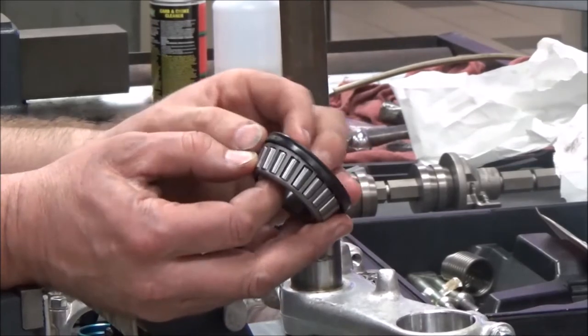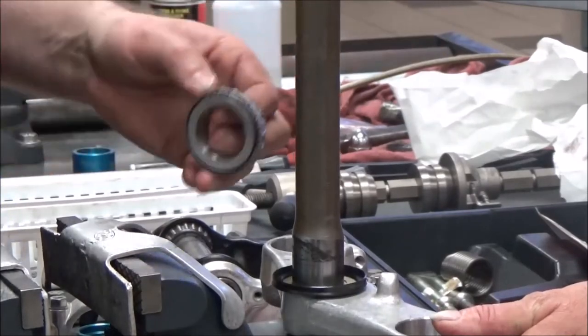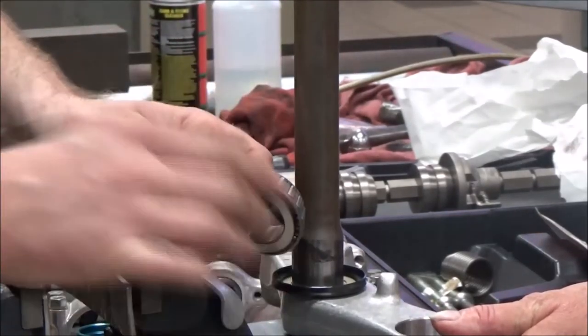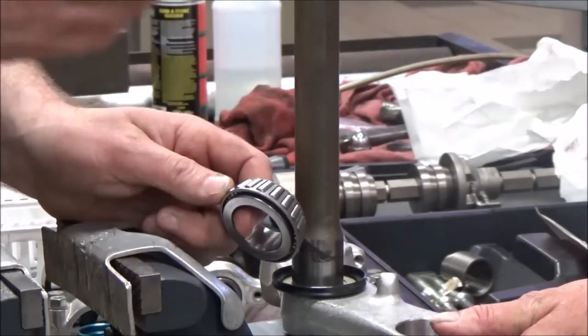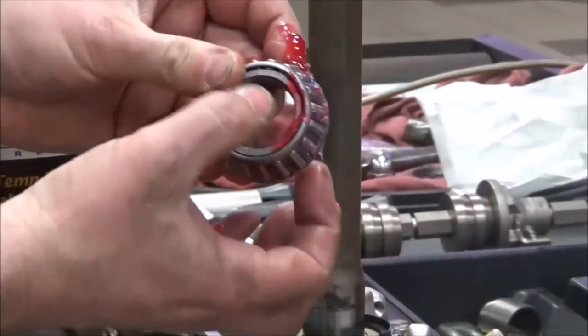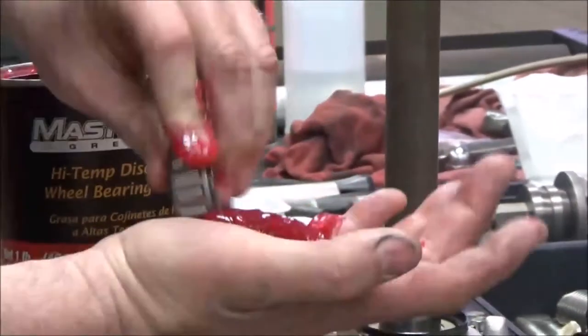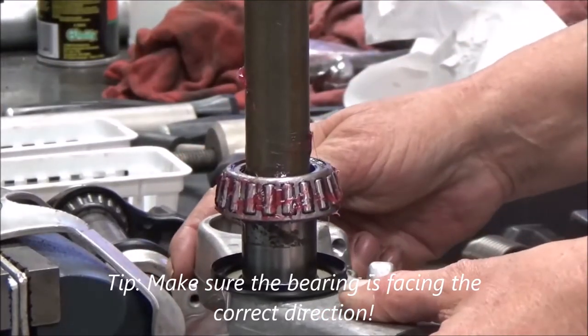This one fits great, so we're going to be good to go. I'll put a link in there. There's something else I'd like to do right now: I'd like to go ahead and grease the bearing, because I can do a better job now than I will once it's installed. You're going to press and you want the grease to squeeze out, so we absolutely need to be sure at this point with our part tool.